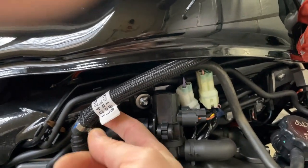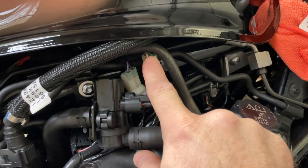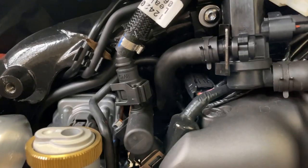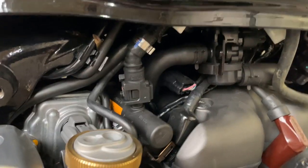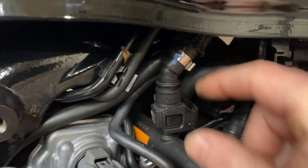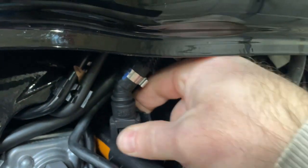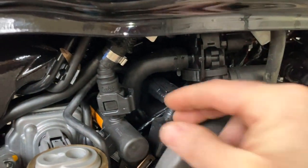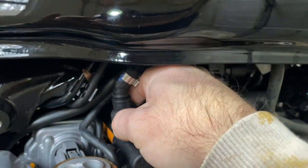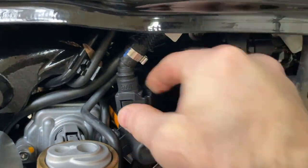The tank is connected to the bike through a fuel line with a clip, and there's also a plug from the fuel level sender. It's actually two clips. The way it works is there's a clip that slides back, exposing a tab on each side — you can squeeze both tabs and pop it straight off the fuel rail. You don't have to remove the clamps or disconnect the line; just press those tabs. An extra set of hands is obviously a huge help here.